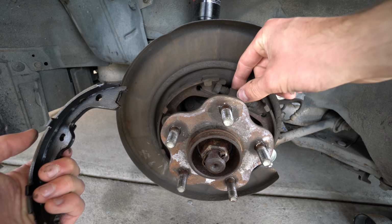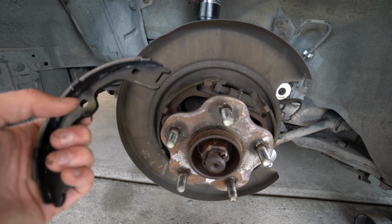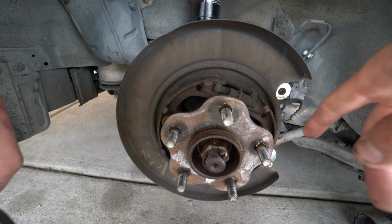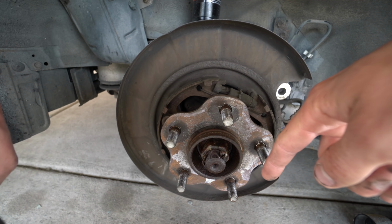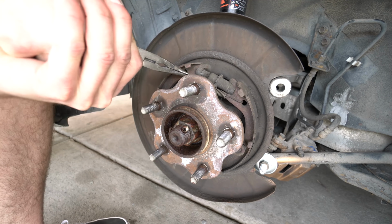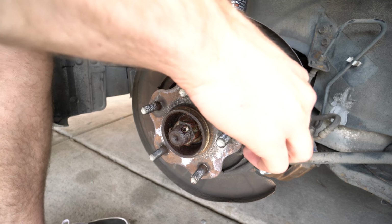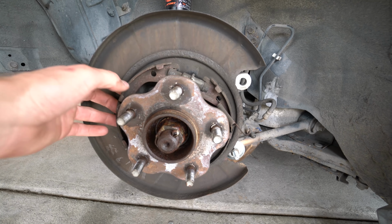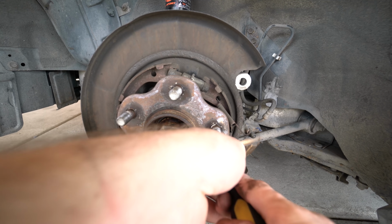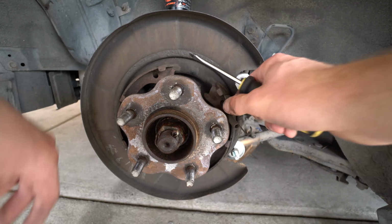And then this could probably be tightened as well right here. If you see those spokes, we can tighten that and get it stiffer so this e-brake should be working good. But I'm gonna take some photos of this whole setup of the springs on the top and bottom before I take it apart. Let's go ahead and start on the top with this spring. Oh, there we go. Yeah, that's kind of loose now. Let's do the one on the left. It's only like a half turn. There we go. Okay. This guy out.